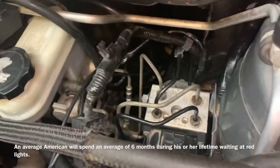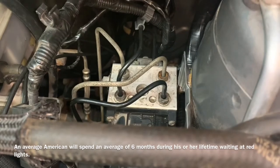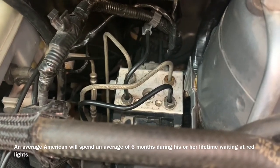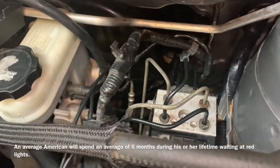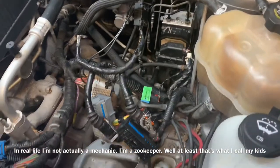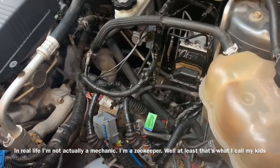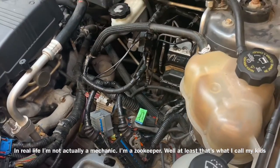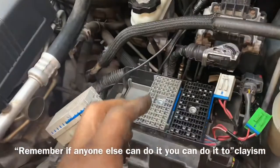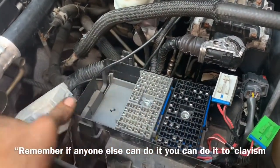I've got an assistant inside and he's going to pump the brakes so we can see if there are any leaks. No leaky leakies — good for me. Now that I don't have any leaks, I'm going to go ahead and replace my battery tray and electronics and plug in my fuse box, and then we'll start the bleed procedure. When installing the electrical connectors for your fuse box, install the gray one first, your black one second, and your white one third.